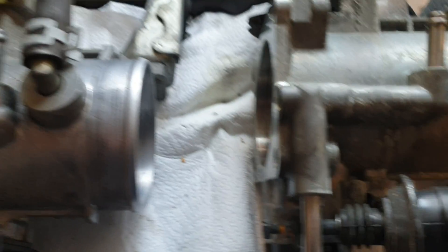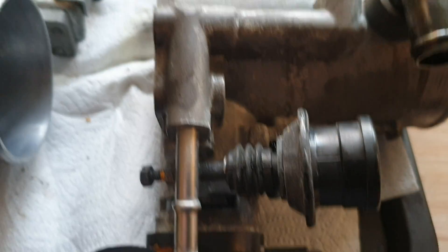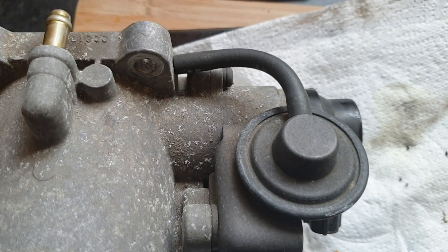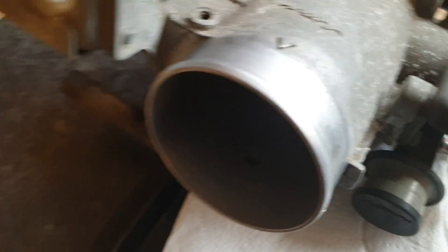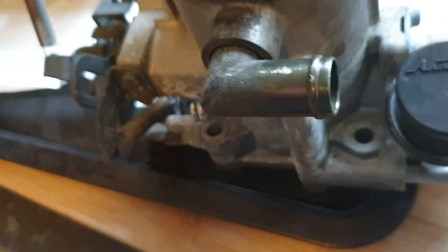This one's facing the other way because I've turned it round 180 degrees - it was facing that way, the same as this. But I want to try and use this for my idle control pipe, because obviously with the boost pipe on it I've got nowhere to take that or put it in. So everything looks the same until you get down there and then everything's not the same. The 96 has got this on the top and the 94 does not - there's not even any extra brackets there. That's the only difference I can find - the bigger breather.